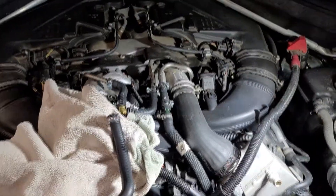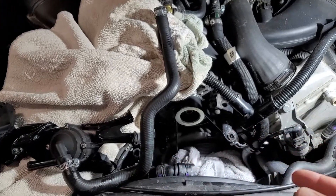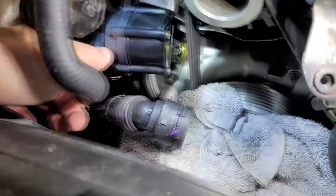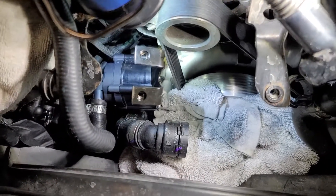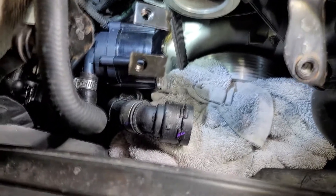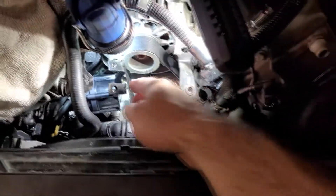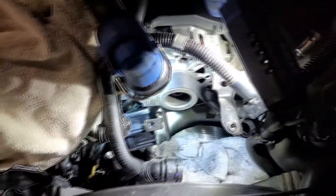I know there's a sequence — you turn the ignition on, press the gas pedal, and it starts the other electric pump that's under that towel way down there. This just helps the process work a little bit better. New pump is effectively on, tightened down. Don't forget your electrical connector — push it until it clicks, then try to pull it back off. If it slides off, you didn't get it locked in.